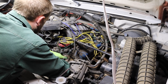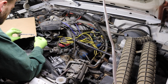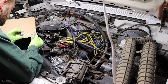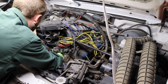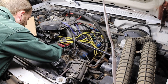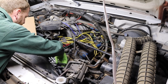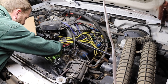I'm getting these bolts in but not tightening them all the way down until I've got them all at least started. Then everything is getting an incredibly generous coat of anti-seize. Because these are steel bolts going through an aluminum water pump into an aluminum timing cover housing, and some even go into the cast iron block — there is a ton of potential for dissimilar metals corrosion, which will cause you a lot of broken bolts and headache if you don't use some anti-seize when you put this stuff together.